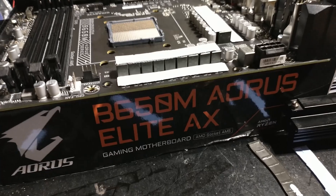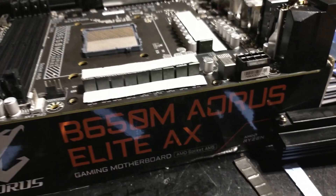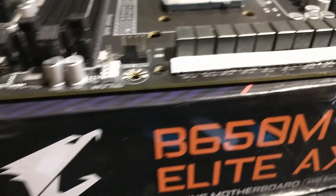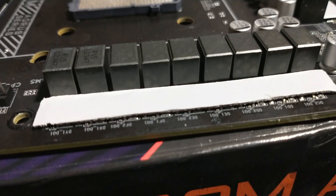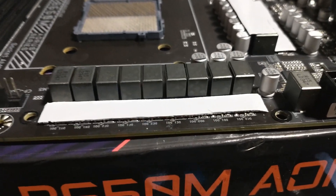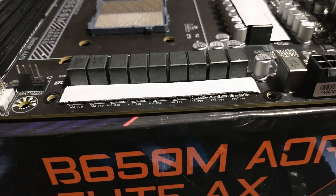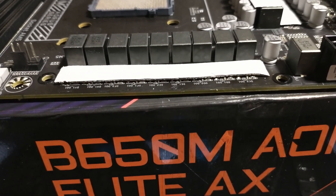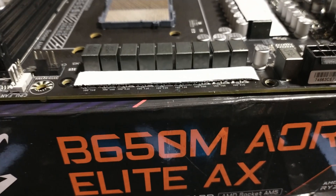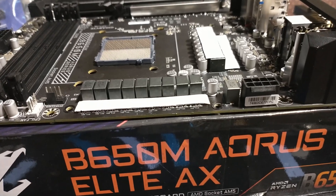We're mostly straight on the board. It's a very thick board, a very hardy board. We'll see how it works. The half-mill pads on the MOSFETs were actually air-gapped and the half-mill pads on the coils were perfect. So I went ahead and pulled off and put one-mill pads on the MOSFETs, and I think we'll be good to go.